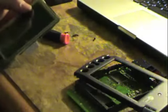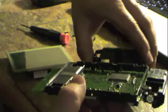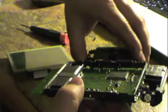It's got a Motorola Dragon Ball processor. I wonder if this fake Palm has the same processor. Yep. Dragon Ball VZ. Probably a totally different CPU. MC68. Yeah, this has an XC68328. So, totally different chip. In fact, we'll compare the boards side by side so we can see what's different.